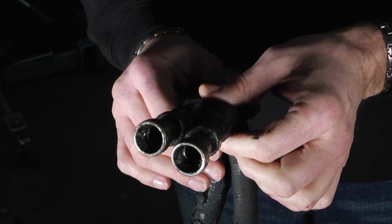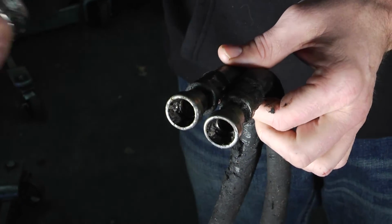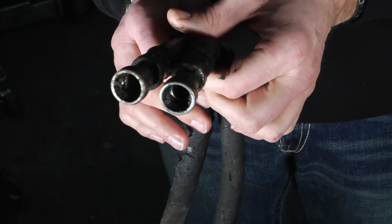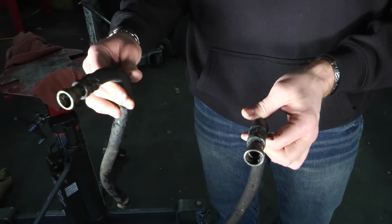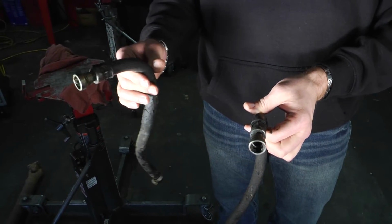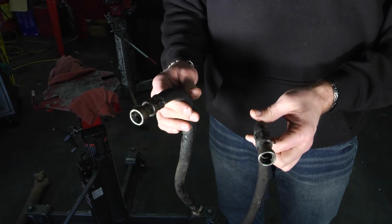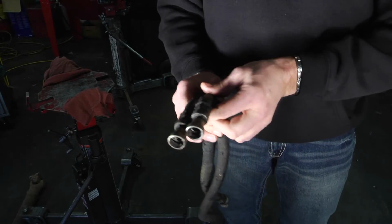It's obviously a lot easier to explain to a customer before you have it reinstalled, or before they have to bring it back, that their cooler lines are looking pretty questionable and there are signs of leaking, and that installing the transmission would be a good time to put those new cooler lines in. We often see transmissions that are installed come back in with cooler line leaks.